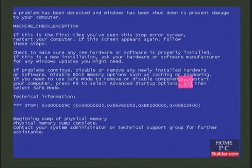When I attempted to restart the computer to go into the BIOS, I got a blue screen. On your computer, whenever you're overclocking and it becomes unstable, you may get a blue screen like this. Whereas usually on my computer, it would freeze and then restart itself. Any kind of freeze, restarting, blue screen, or error message are all signs of an unstable overclock.